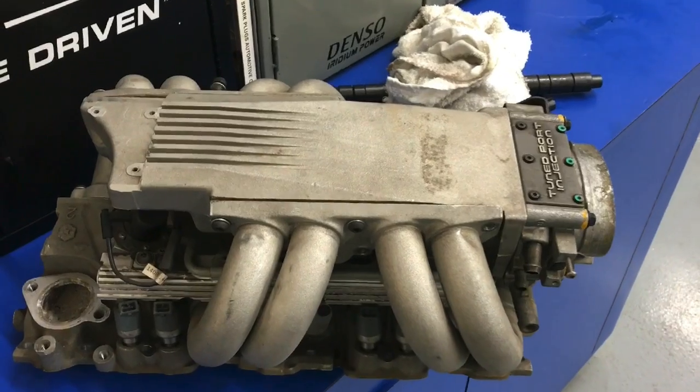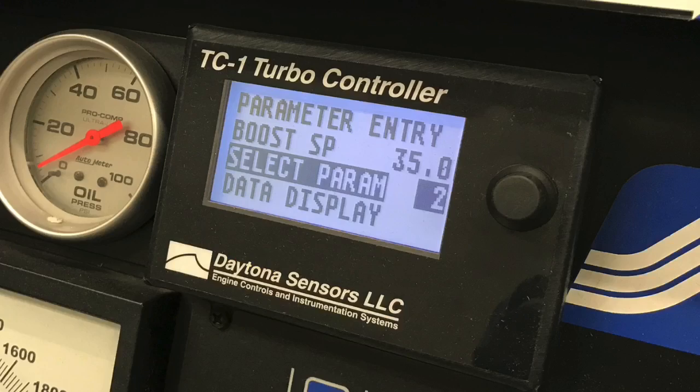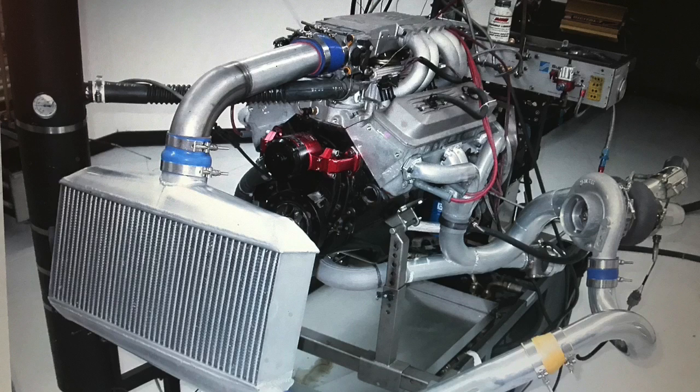Let's get to our conclusion. What did you think about our turbocharged tune port L98? I love the tune port stuff — in my opinion, that's one of the coolest factory induction systems GM ever offered. It looks like a Klingon warship, which is totally cool. But it also shows that adding boost to whatever combination you have basically just elevates whatever's there. The one way we could change that is if you produce a rising boost curve with an electronic boost controller that's RPM activated — instead of a consistent 8 or 9 pounds of boost, you'd have a rising curve more like a centrifugal supercharger provides, which can actually change the shape of the curve and make peak power at a little bit higher RPM. But I love these tune port motors. And you know what I love even more than a tune port motor? A turbo tune port motor.